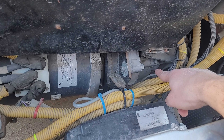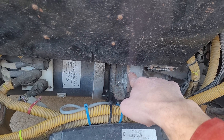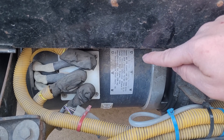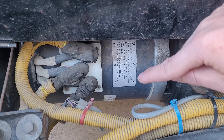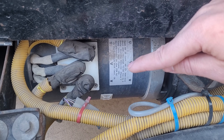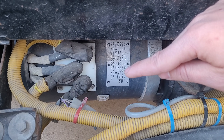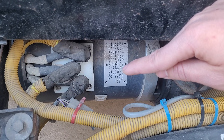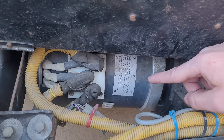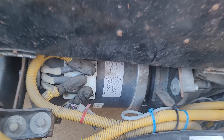It's still manual, so that's the manual transmission there, and this is the motor. There's a coupler to attach the motor to the manual transmission input shaft, and it still has the clutch. This is an AC 31 motor — peak horsepower is 35 and continuous horsepower is listed as 10. That's very underrated. I drive this on the highway quite often, pulling 15 to 20 kilowatts, which is like 25 to 30 horsepower continuous, for 30 miles on end, and it does not heat up. This motor is kind of meant for performance golf carts, but it works well on this very light car.